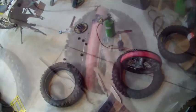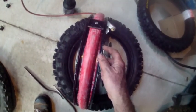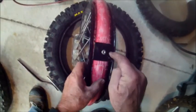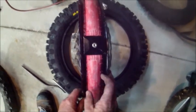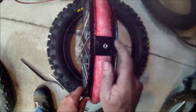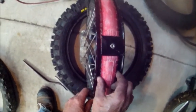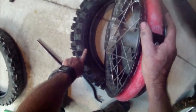So there you've got it. I've left the air pressure out of this thing, so it's nice and soft. When I go to mount this tire, there'll be plenty of room for the bead to seat down in here. Once the tire's on, this is part of the rim lock too — standard nut on the end of this, you'll crank it down and that's going to push down and help grab the tire bead right there as well. This hole is the pass-through to the valve stem to get air into the actual chamber of the tire once it's all on. Series of events: tire goes in, tire irons seat the tire inside the rim properly, tighten the rim lock down, put 125 pounds of air in the inner tube to lock the bead against the rim, then put four pounds of air into the tire chamber.